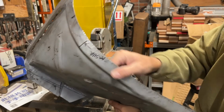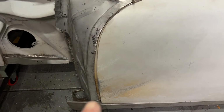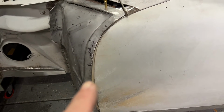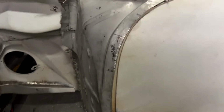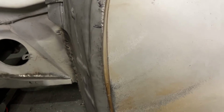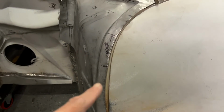A little shrink action. We're sneaking up on it. I'm out of breath. You can see down at the bottom, we're getting tight. A little bit of a gap like we thought. But that's tightened up through there. So where we've got the mark for stretching, starting to look pretty good. Then it looks like, or sorry, the mark for shrinking. Looks like we need to stretch just a little bit through here, through about that line to maybe there. Just straighten that out just a little bit.